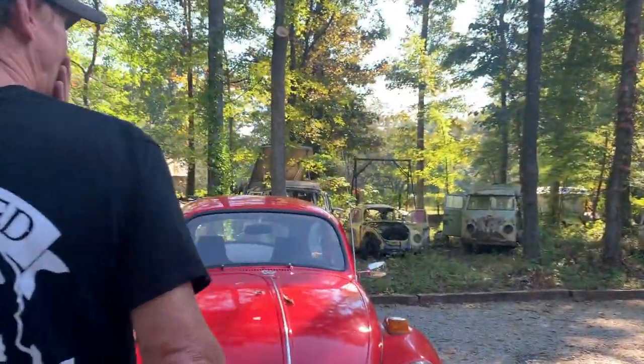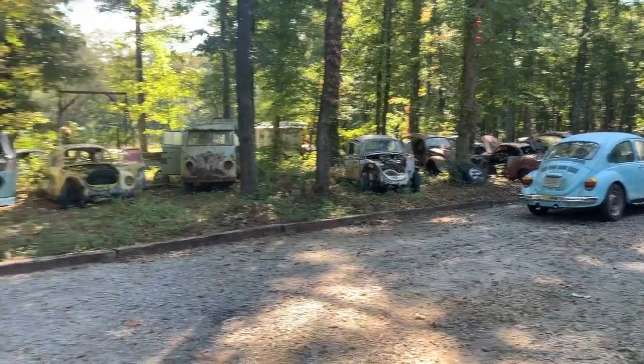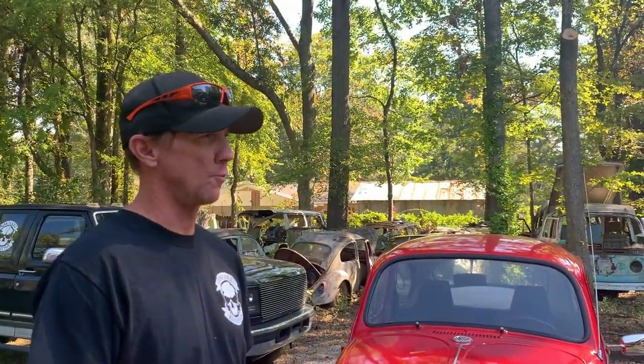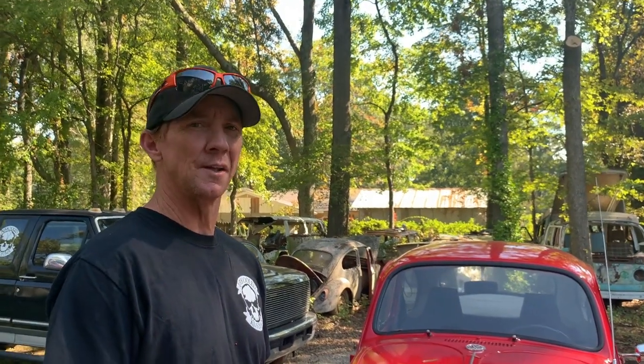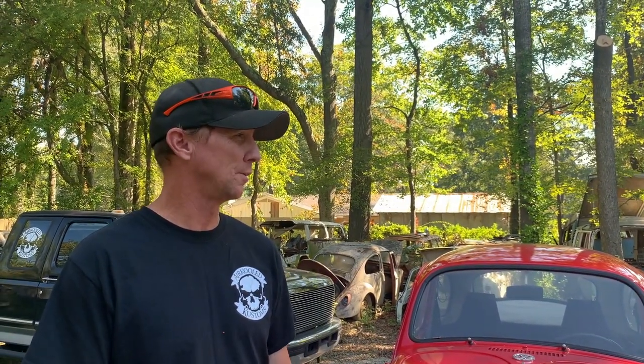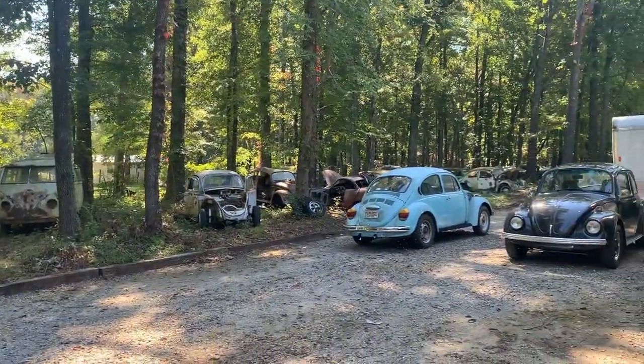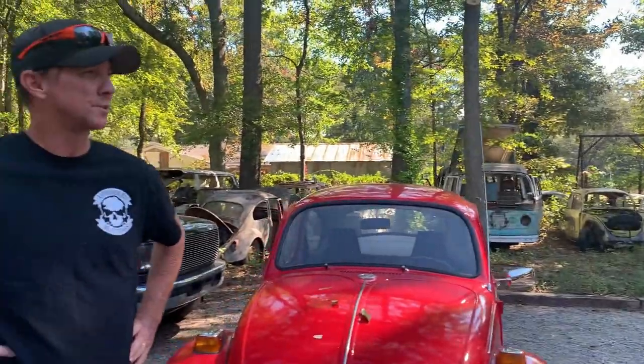Darren, what is going on? You got a lot of bugs — beetles everywhere. That little blue beetle over there, we call it the wedding beetle. He contacted us and wanted to get it running for his wedding. They're going to drive away in it. It was sitting outside for three years, it didn't run, we brought it here, diagnosed it, got it down to where it needed a starter, put the starter in, and it fired up and ran — the old gas was still in it. Had to do a couple other things to get it tuned out and do a bunch of wiring stuff to get the headlights working. It is the zombie apocalypse vehicle for sure — a '73 beetle that just came out of the woods and started running.